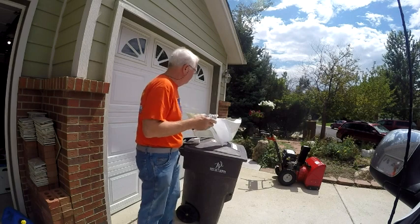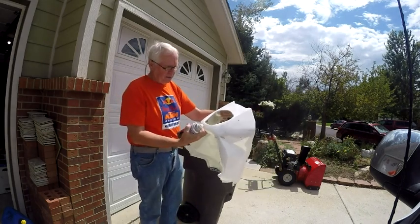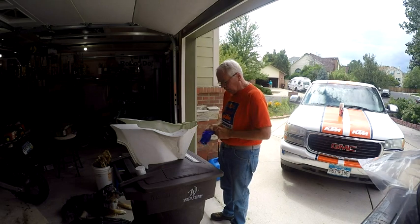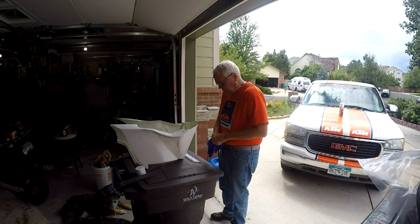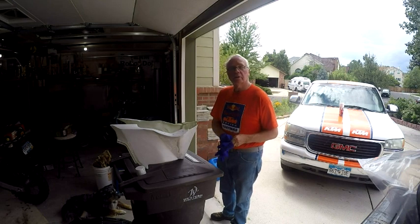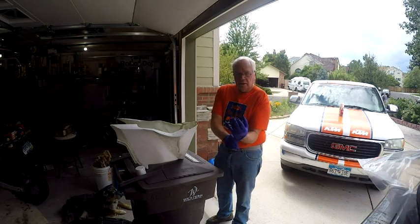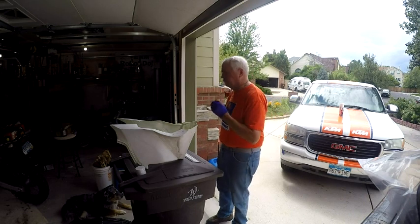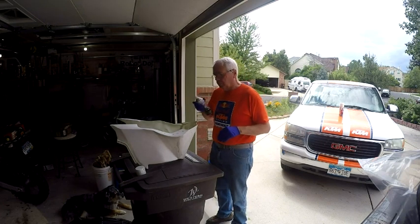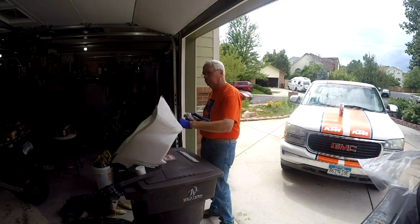This stuff ain't fun. I'm just trying to think if I can hold on to this thing without getting myself covered in paint. I moved it into the garage area to get out of the direct sunshine. At this particular point, I don't really care how great the paint job is. I just want it white so I can put some graphics on it and ride and get ready for the KTM Orange event in about a month from now. So I just want the darn paint to stick. I've wiped it. I've sanded it all down with 300 grit sandpaper.